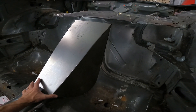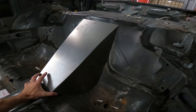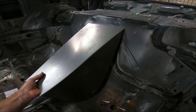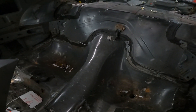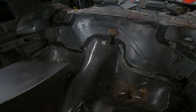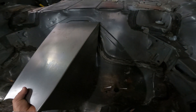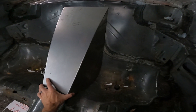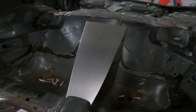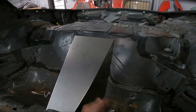So if you're going to drop your car really low and need a lot of suspension travel for your torque arm, this is an easy solution — cut the floor out in the tunnel area, drop that panel on there, stitch weld around it, put some seam sealer on it, and you're good to go. You've got all the room you need for the torque arm to move up and down.